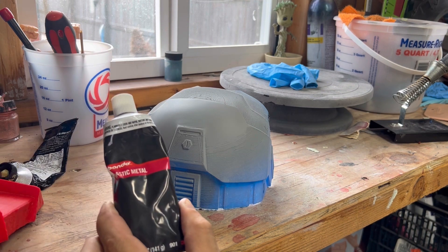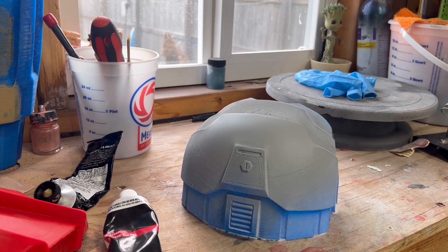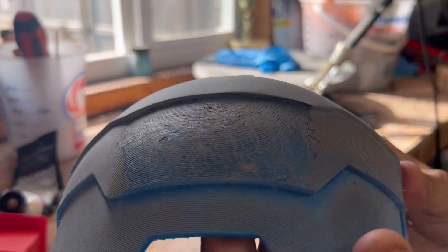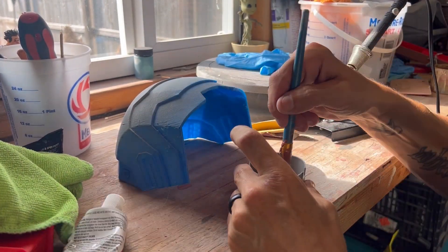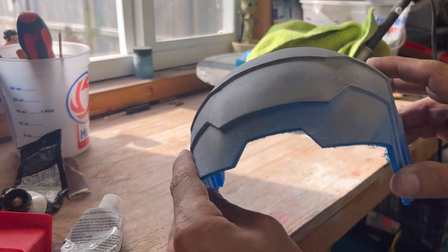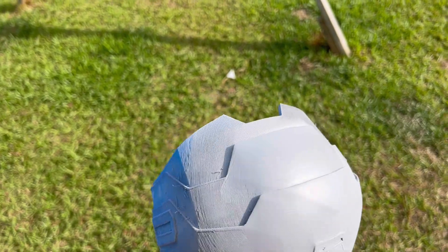After that final sand with the 320 and 400 and one last light coat of filler primer, here's the result — this is obviously untouched — quite the difference, and in a pretty timely manner. The plastic metal and the Bondo filler primer both dry really quick — great method, great products. For a fair comparison I went ahead and did the other part of the shoulder using the same technique, except I did thin down the plastic metal and brush it on with acetone. The only thing I recommend when brushing on is to do two coats. Using all the same sanding media and same coats of filler primer, it came out absolutely awesome — the top pretty much matches the bottom, so both application methods work great.